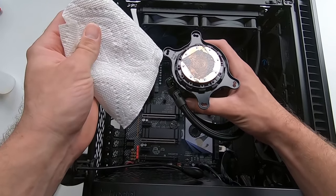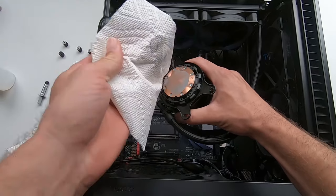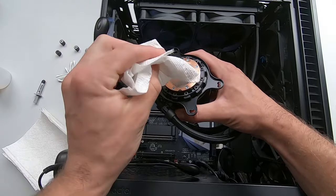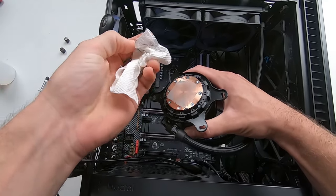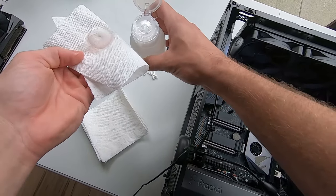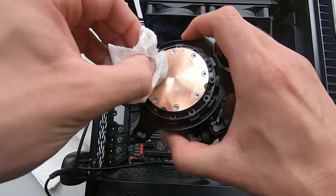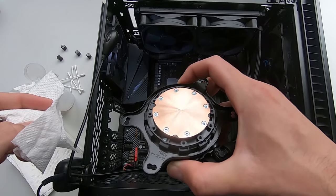I've had that happen before when I put too much thermal paste on, but don't worry — be patient and don't use too much force. Once the cooler is off, go ahead and take your dry paper towel and wipe as much of the old thermal compound from the cooler as you can. Some like to go straight to the alcohol but I've found that doing a dry wipe first can be cleaner. Then apply the alcohol to a new piece of paper towel and wipe down the cooler. Make sure it's nice and shiny and clean.